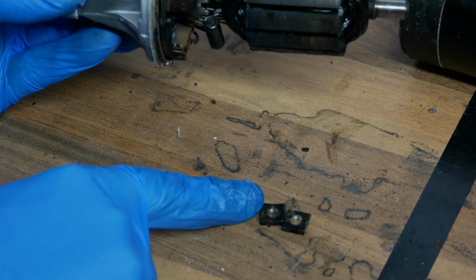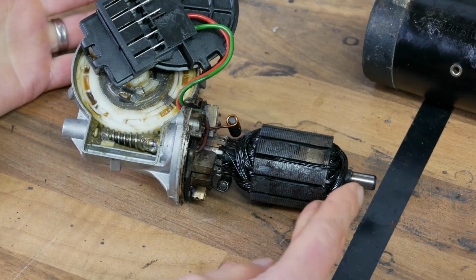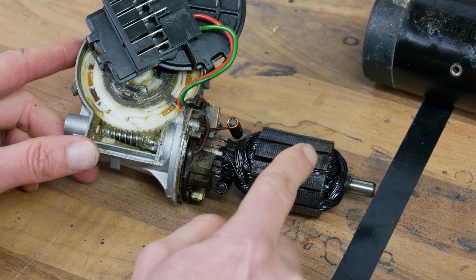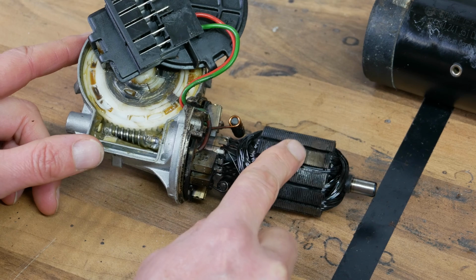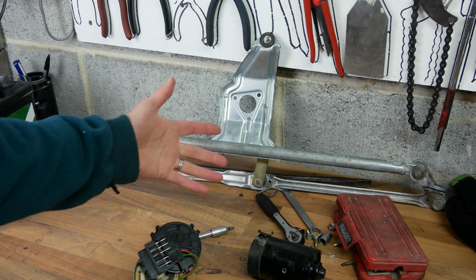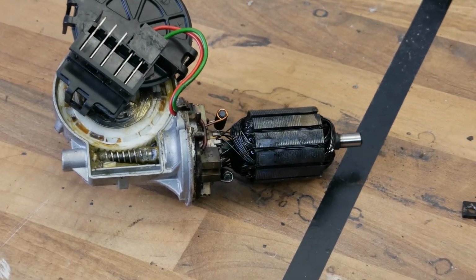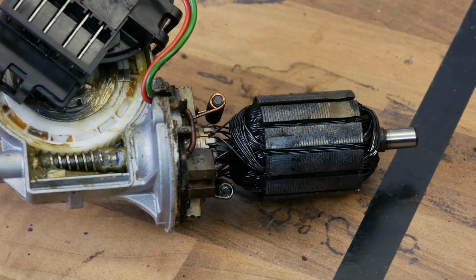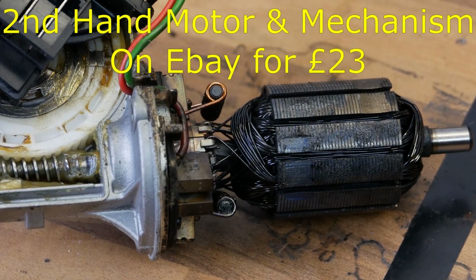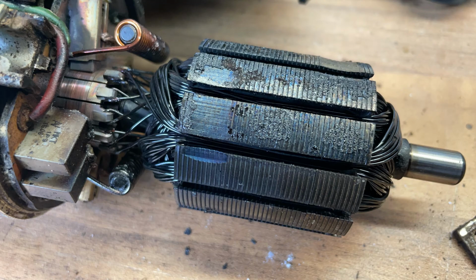These two things are just the nuts that the screws were in that were holding the housing on. So I won't go into it in lots of detail because this video is not about how electric motors work. All I needed to know is, has my motor failed, in which case I need to replace it to get my wipers going again, or has the mechanism failed, in which case I need to free that off or do something with that, otherwise I'm going to keep losing motors, you know. And for this situation I was showing you, the mechanism seemed fine, although of course I did the work to clean it and grease it. But you can see from this picture that the motor's clearly burned out. Bear in mind that if the mechanism had been really stiff, then also it can cause the motor to overheat and burn out. So it just depends on what your situation is.